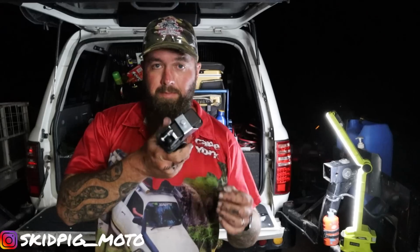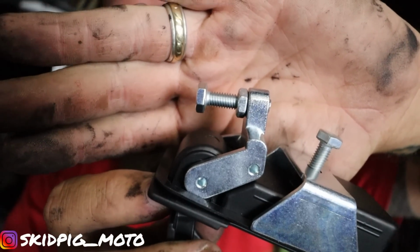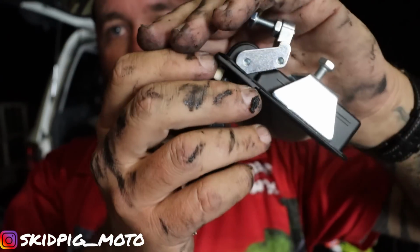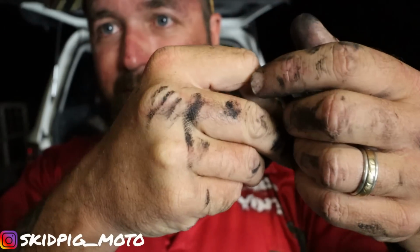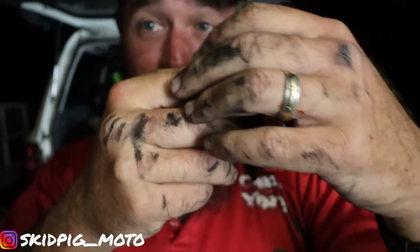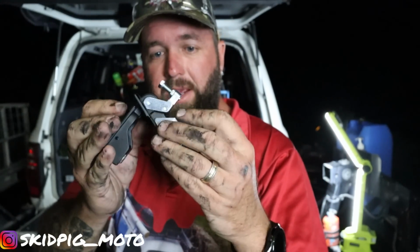Hell yeah. So your locks have got a 10mm bolt on the back of them. So just undo that to get that bracket off. Then you can sit them in. And all you have to do is set the adjustment on that bolt there. And that'll give you your tension when you close it. And that sound deadener stuff, it's pretty sticky. You're gonna get a bit of bark off you too, just, you know, sharp edges. But that's pretty much it. So we'll bang them in.